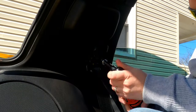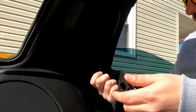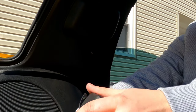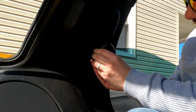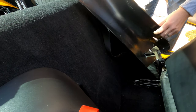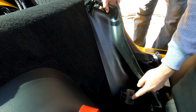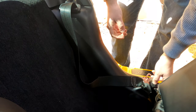That reveals the first T50 Torx bolt that you have to remove. With that removed, I'll take this little plastic piece off the seat belt and put the bolt back in so I don't misplace it — ready to go when the new belts come back. There are two clips on this surround trim: one up top, one down below. As you can see from how these clips are angled, you just have to pull this plastic piece straight towards the inside of the car to release those two clips.